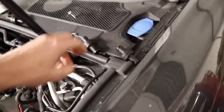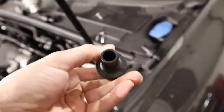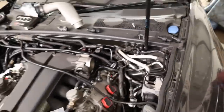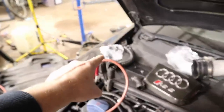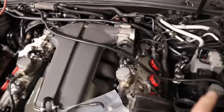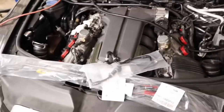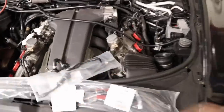One of those valves was completely broken and not working, and the other two were okay. But when I went to do a video on this last week I actually discovered that those two other valves were also playing up and not 100% working, so I ended up ordering another two valves. So we actually have five new non-return valves and this new pipe across here. There should be no issues with the PCV system after today's video.